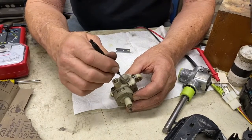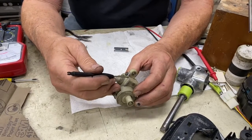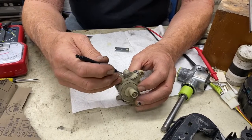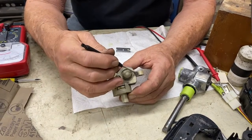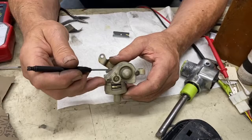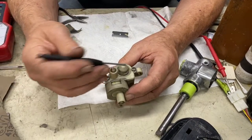The two-screw plate that holds it in place here we finally sealed with RTV silicone gray. I tried a gasket, I tried a lot of other things. But when you're pulling down on these outer appendages, it's plastic — it's going to bow in the middle. So gluing it in place did that.